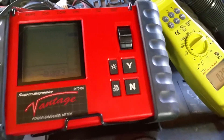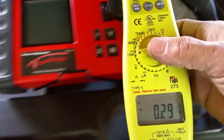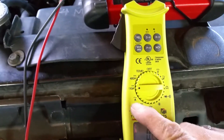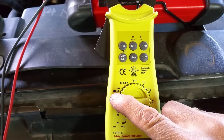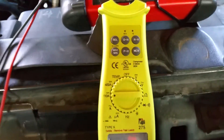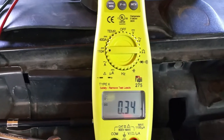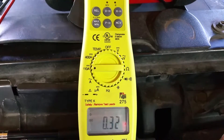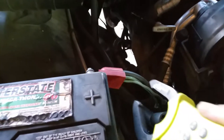One thing to make sure of is that we don't have more than 10 amps, so we don't blow the fuse out of this piece of test gear. What I like to do very first thing is get an amp clamp. We can set it on as low as 110 amps DC or also 400 amps DC. Right now, 110 amps is more than plenty to see if this thing is drawing more than 10 amps. The number is reading down here at 0.3 amps — no big deal if we're off by 0.3. We're just looking for a major draw, more than 10 amps, that would take the fuse out of our equipment before we hook our equipment up. So let's clamp it over top one of the wires.